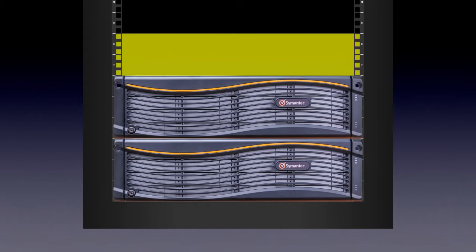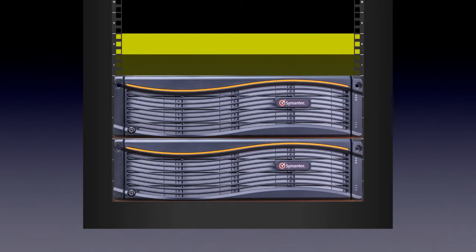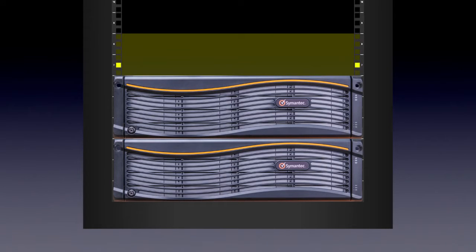the appliance will be installed, remembering that the mounting rails are installed in the top U of the 2U space, and M5 snap-in cage nuts will be installed in the center hole of the lower U of the 2U space.